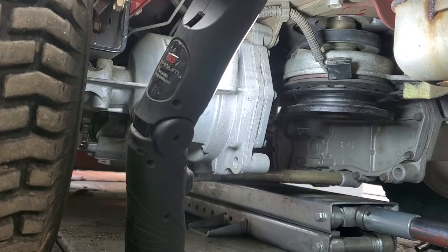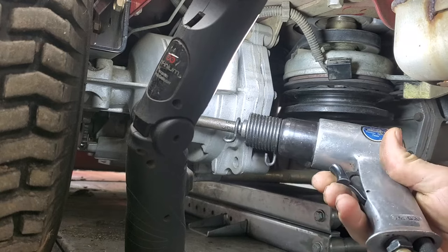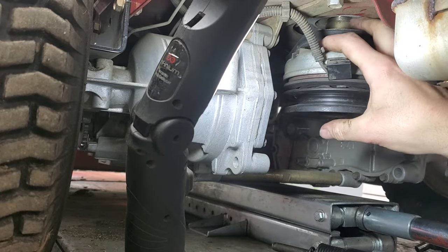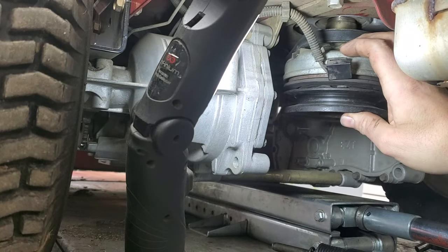I'm going to show you how to take these things off nice and easy. You can use either a hammer or you can use an air impact. We normally just spray lubricant up here at the top — your choice of lubricant — liberally, and then in between this pulley here and the clutch, liberally also.